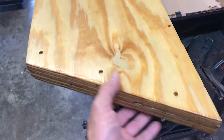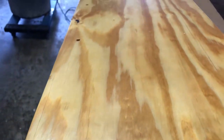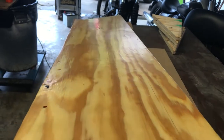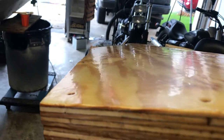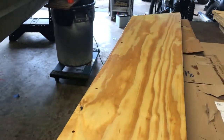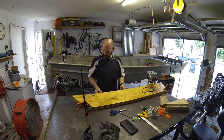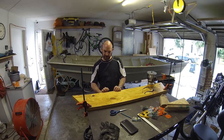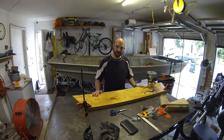So this is the new wooden transom with two coats of Bondo fiberglass resin on it. You can really feel it — this thing is coated. You can see the gloss there. This thing is solid — no water is going to get through this. This is going to be great. Quick little update: we went to dry fit this in, and the top is just slightly too tight at the top of that channel — the channel's not really gripping over it. So what we're going to do is router down a little bit of this, it's going to create a little lip, we're going to re-Bondo that. After it's all sealed, then we're going to get it in.